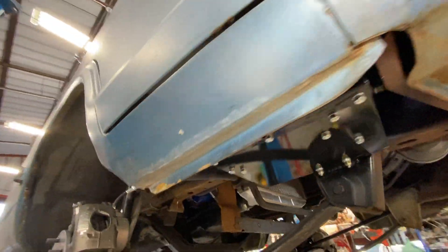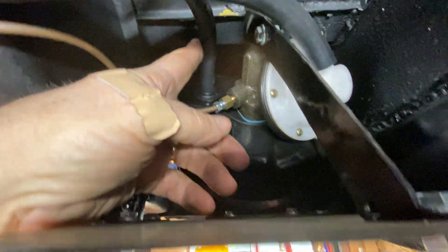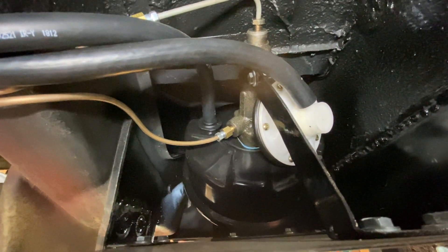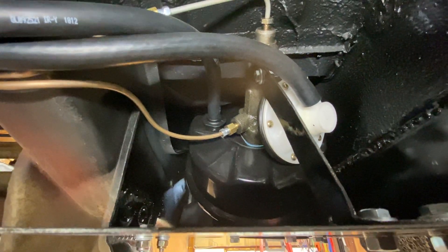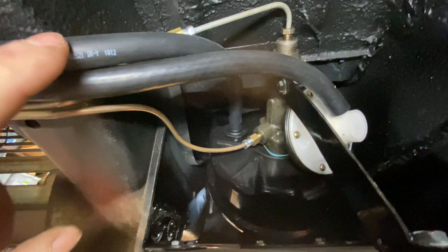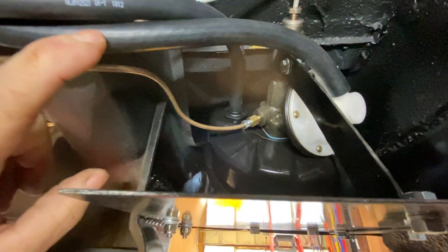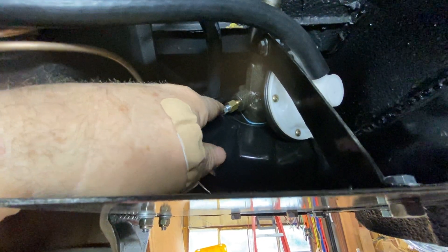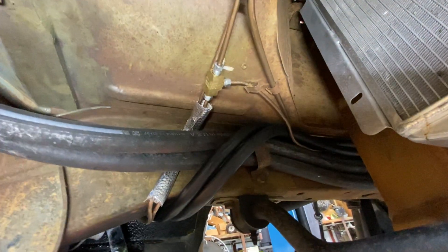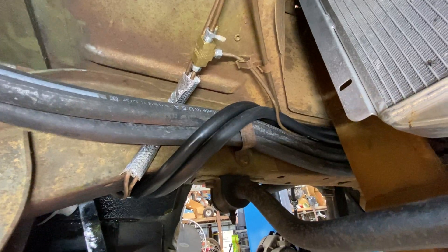This is how he mounted this power booster underneath here. Let me get a view from the front. We can still unbolt that and drop it out if there's ever a need for servicing. You've got this one vacuum line going in — that's the supply, and then this is the vent, just a hose that goes up with a small filter on the end so we have fresh air, nothing close to the bottom of the car with dust and debris. So basically: vacuum in, this is the pressure relief, hydraulic line in from the master cylinder, hydraulic line out — and that's the one that goes out and splits to left front and right front.